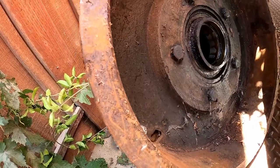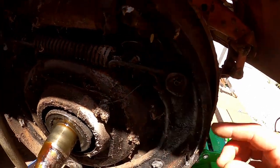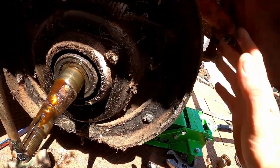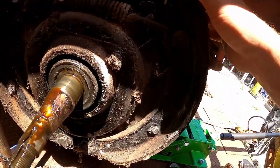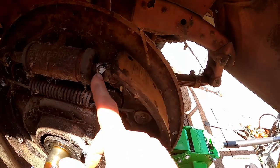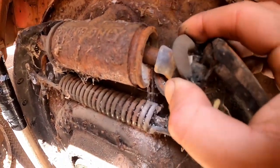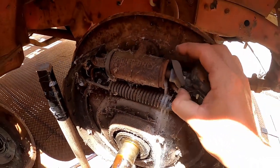It turns out the bolts are on the inside of the brake drum, so I didn't strip anything. Looking at how this brake drum setup works, there's an adjuster attached to a bolt head on the back side that adjusts the shoe. As the shoe wears out, you can adjust that bolt to push it closer to the drum so the brakes work better. I noticed there's a complete gap — it's not even touching — so this cylinder is not fully recessed. When I pop the boot off, it's just full of powder, like the brake fluid dried out in there.